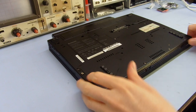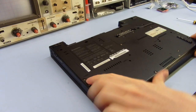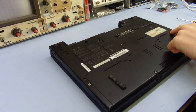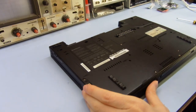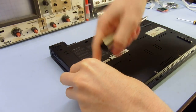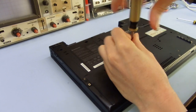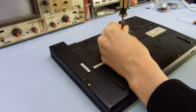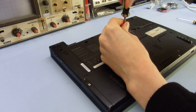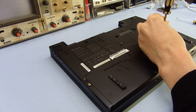First of all you want to switch the laptop off, close the lid, and take the battery out — then put that aside. Now I'm going to take out some screws: these five here, including this little one, and then the two in the corners for the speakers and grill. If you're just taking the keyboard out you can just do these five along here, but we also need to take off the surround part that has the speakers in it. This one's a bit hard because it goes straight to the keyboard and it kind of flicks when you try to unscrew it.